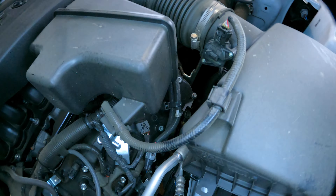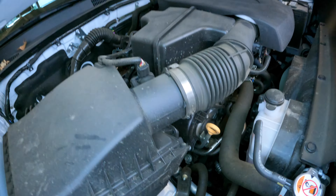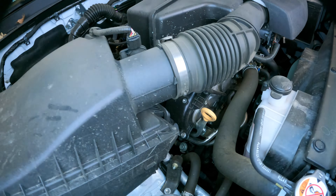So you're ready to pull up and get this air filter out. How often should you replace the air filter? About every 10,000 miles in extreme driving conditions and up to 30,000 miles in conventional driving conditions.